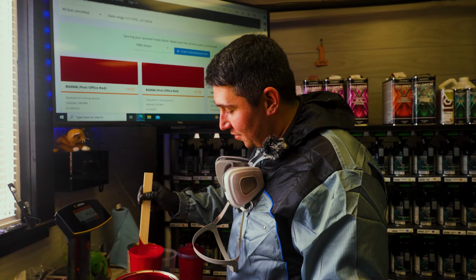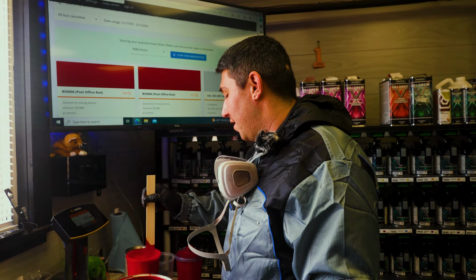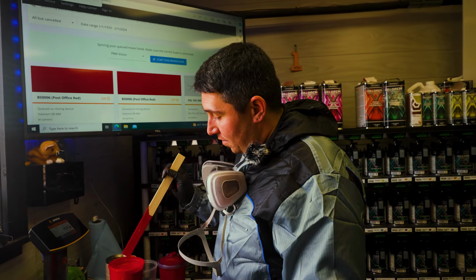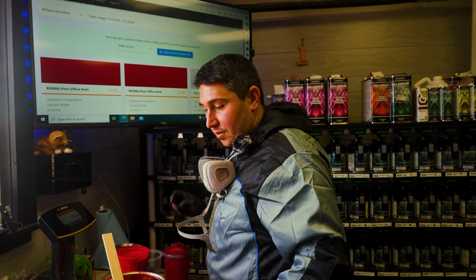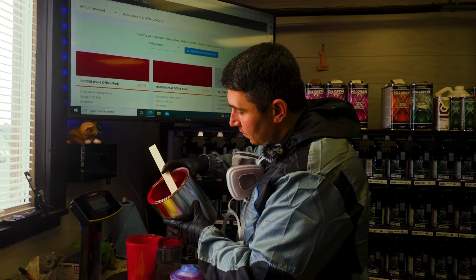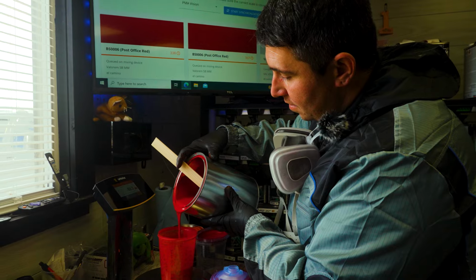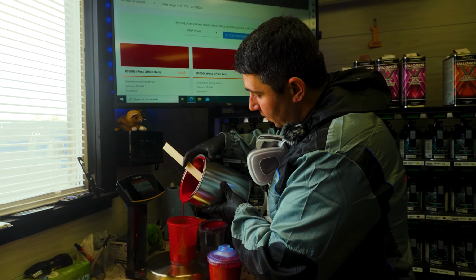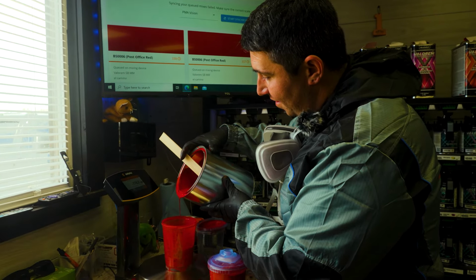It allows me to spray my base wet like I like to. You can't spray base dry and all that. The fan was really, really good. The output with that nozzle size and the atomization was just right on par with what I was expecting, to be honest. I look forward to trying the clear gun, because if that one can lay base that well, I can only imagine what the clear gun's going to do. I think you're going to love it.